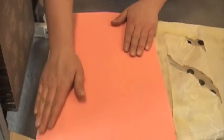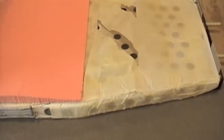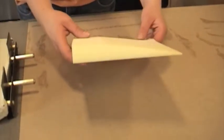Be sure not to spray adhesive on the metal tabs in the proximity of the shoulder harnesses, as that is where the seat belts will slide back and forth. Remember, only the flat, non-beveled side of the foam will be glued to the seconite shell.